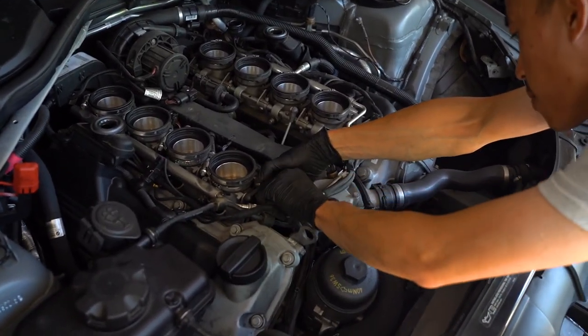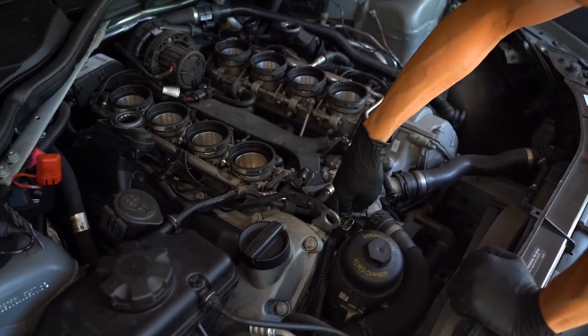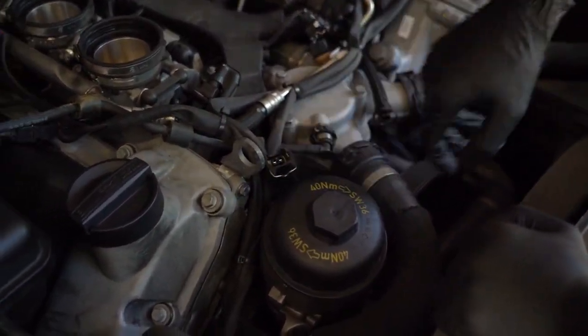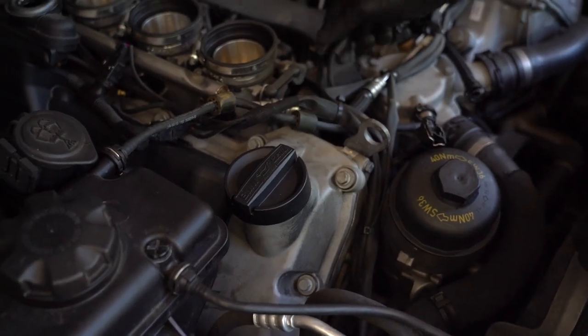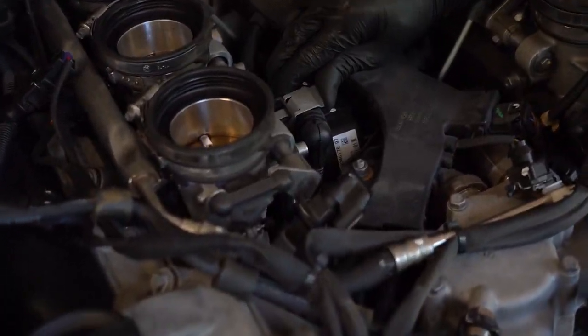Undo this one. That, and then you have this connector down here, which is the oil pressure sensor. Lift this one up like that. That way we have room to be able to move this upwards after. So that's good, that's off. And then you got this one, which is the O2 sensor. Unclip that,